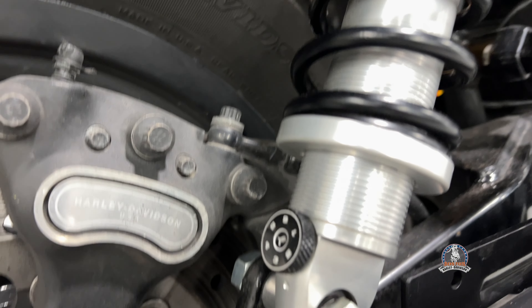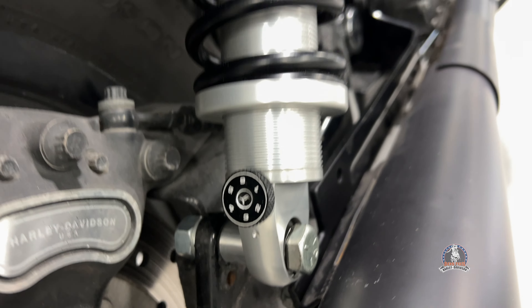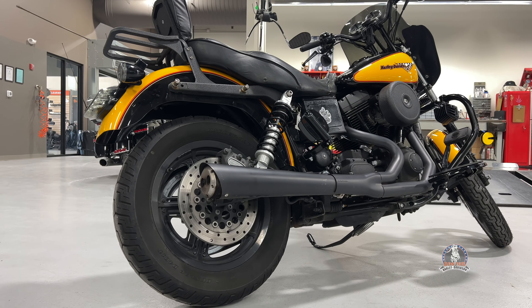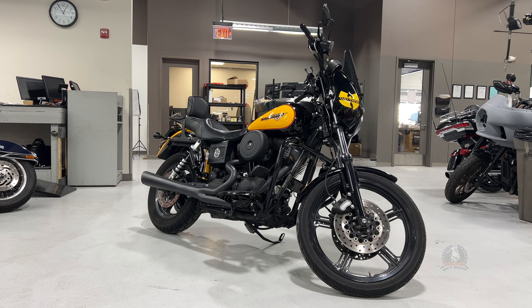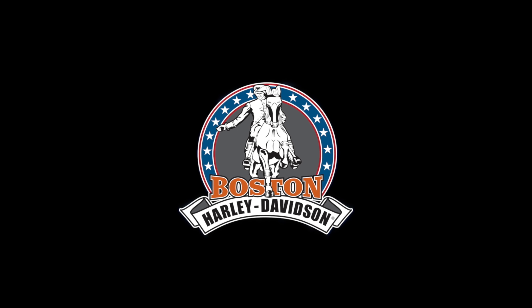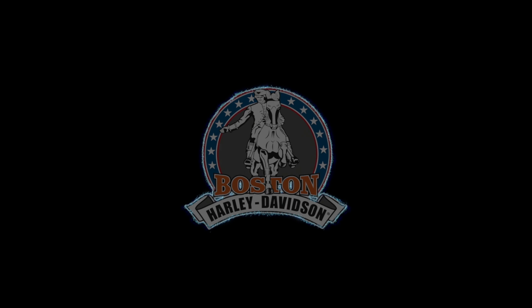Now last, but most important, is all about the ride — the Legend suspensions. I went with the 14-inch shocks. My bike's an FXDX; it came with 13 and 3/8 shocks. They don't have any half sizes, so I went up to the 14. We set the sag at an inch, so it lowers it down. I'm real happy with it. Getting ready to go to Daytona — see you there.